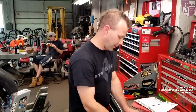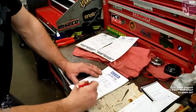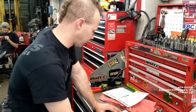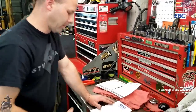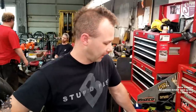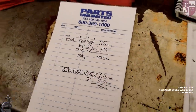For the rear, we write down the rear free length of 615mm. There's only one measurement needed because we don't have to account for stiction — the linkage bearings are almost always in great shape on a street bike. We got 580mm with the rider on, so 615 minus 580 gives us 35 millimeters of rear sag. According to Race Tech that's good; according to BMW they want 8 to 12mm, so we would have really had to crank that spring — probably almost into the next spring rate. That's really it for the worksheet — just wanted to show how it looks and how the math works.